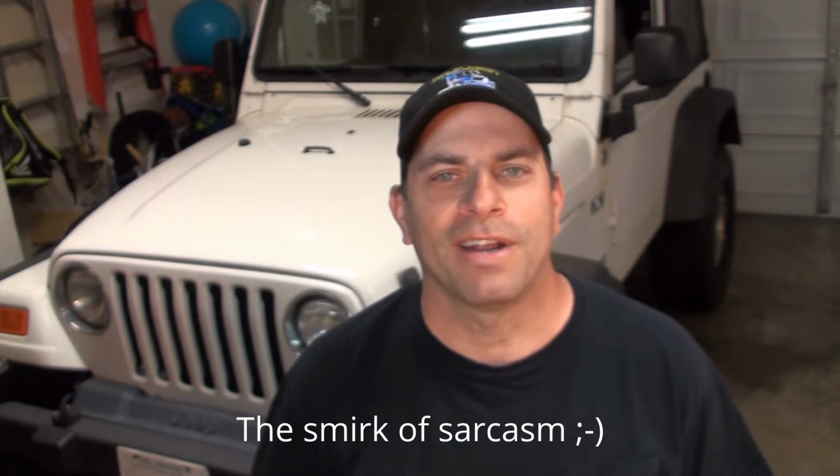Today we've got this beautiful '06 Jeep Wrangler right here. It's got the 4-liter, and the problem it's having is the owner tells me the air conditioning is working on and off sort of. So let me explain. You go down the road, the air conditioning's working fine, cold air is coming out of the vents, and then after about 10-15 minutes, nothing. It's just basically no air hardly coming out of the vents at all, if anything. And then later on, it comes back, it's cold again.